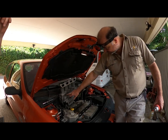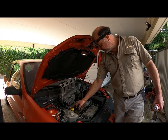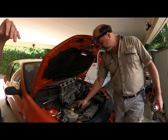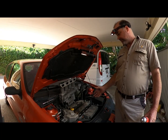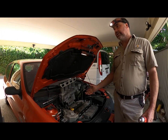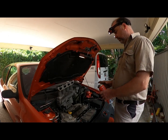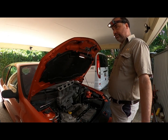So they've run the thing. But see these marks here? Well, that's these leads, and that's the insulation the factory lead has. But when you buy leads, it doesn't. Now, a lot of people have forgotten that leads don't like to touch stuff, because nobody sees leads anymore. You work on 100 motors, you don't see a lead.